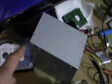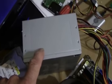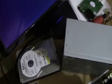Your AC is inside this box. You do not want to go inside this box. And you definitely want to make sure you have a grounded wall plug, because if something happens and this case gets energized accidentally, you'll get a hell of a zap. Alright, we're going to turn it on.